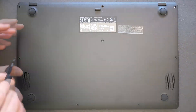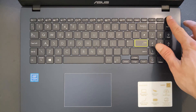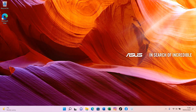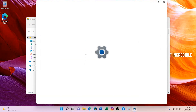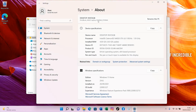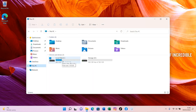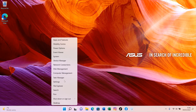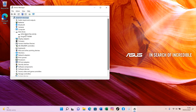Screws will go back in now, and in just a second we're gonna go to Windows and see what's going on there. We're in Windows - I'm gonna show you a few specs of this laptop. Go to This PC and Properties. As you can see there's 4GB RAM and an Intel Celeron CPU, not the fastest one. You can see here the new drive I installed - 128GB - and the old one, 64GB. I left the old one just for storage. Go to Device Manager and you can see both drives are there, so it's working. It's guaranteed to work with the extra drive.